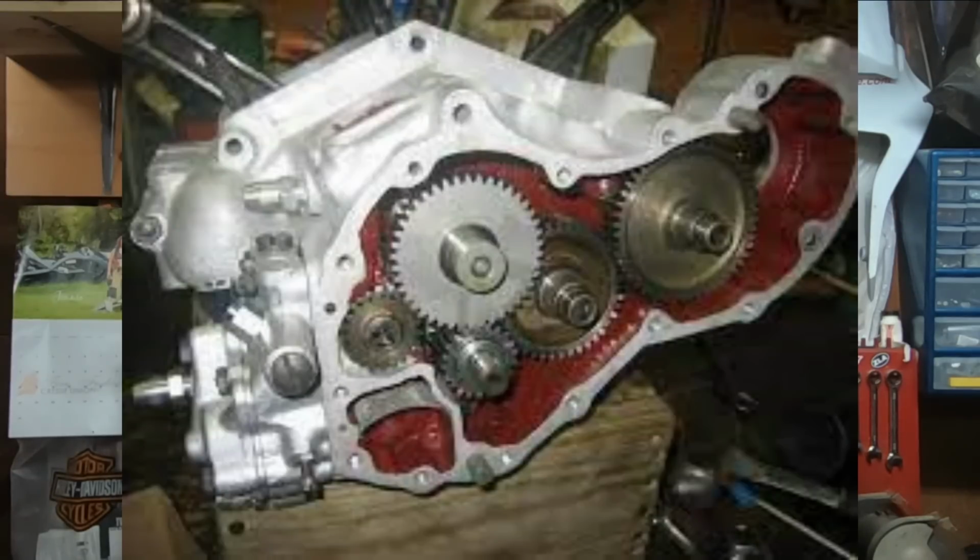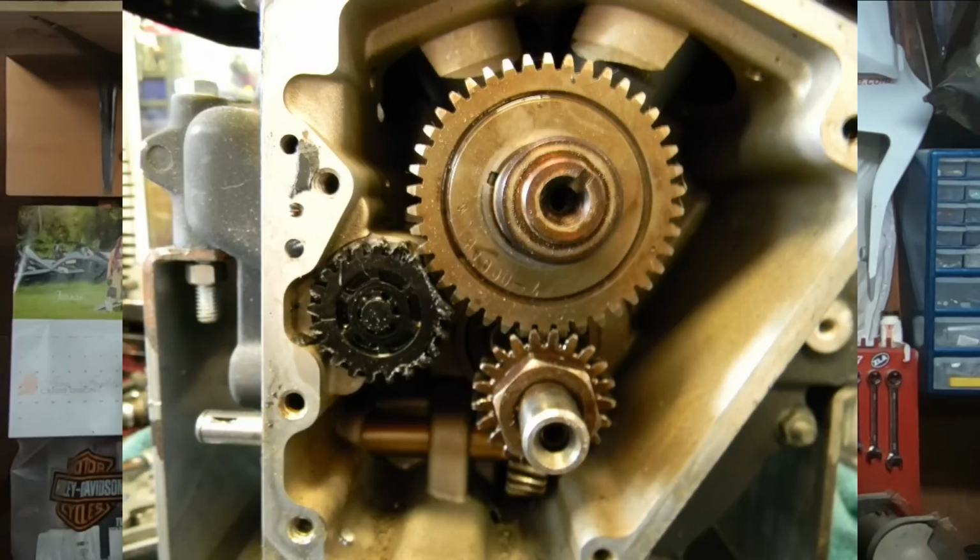Now the valve guide seals, they're now alloy steel instead of bronze, and now we also got a larger diameter pinion shaft. Now here's the best part about these upgrades. The inner cam bearings actually became a full complement Torrington bearing for that inner cam bearing. Now where have we heard you need to convert to a Torrington bearing before?